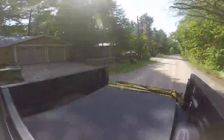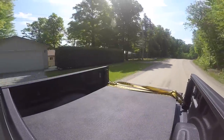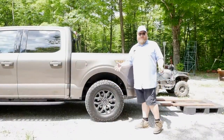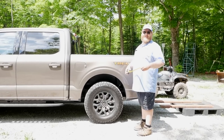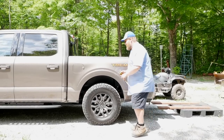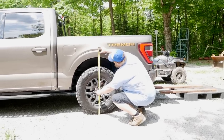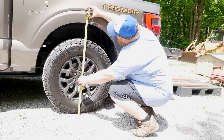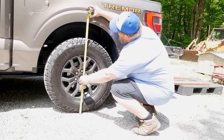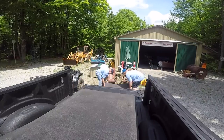We'll head back and measure the squat to see if this Tremor squats any more than a standard F-150. The Tremor gets unique suspension compared to a regular F-150, so once we're done here we'll be able to compare. Going center of the tire — that is 39 and a half inches loaded. Now we'll strip out the rubber mats and measure again.